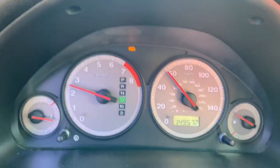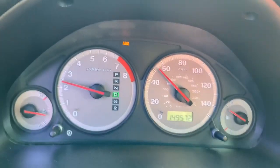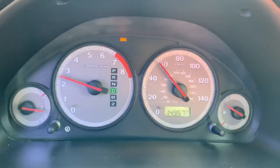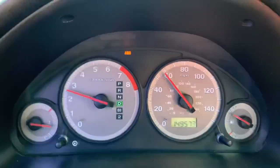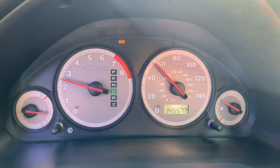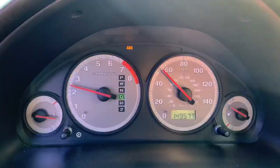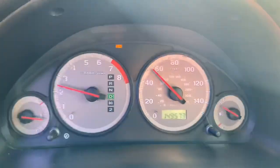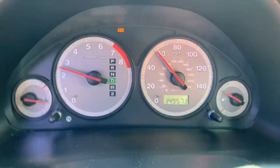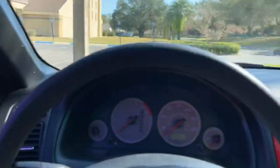As you can see, I do not have any codes on my dash. The check engine light will come on in a few minutes of driving at this speed. All that is — from what I've read on the forums — is that the torque converter in these SLXA transmissions is just a little bit smaller in radius than in the BMXA transmissions. That will cause the sensors on the transmission to read it going at a different RPM than what the computer in the vehicle tells it it should be going at, making the check engine light come on for the torque converter clutch open. I'm going to try to get it to come on and then I'll read the code and show you what it says on my scanner.